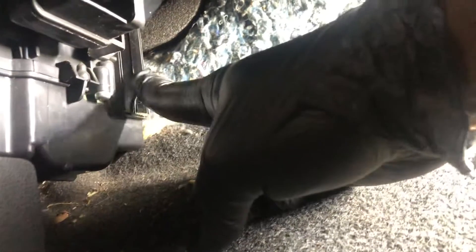This slot here should have a door to secure the cabin, but this customer declined the new cabin filter and didn't have a door — there should be some kind of door here. You would remove that door first and then take your cabin filter out. I already have the cabin out; I'm just going to show you guys how to put it back in.